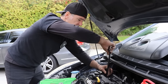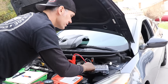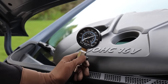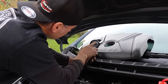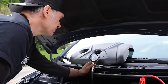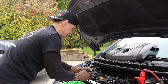Based on the Kia manual, we need to have at least 164 PSI minimum, and it should be around 185. We're going to hook up our Noco here to make sure we have a good 12-volt supply and give it a little boost. Hold the gas pedal to the floor and crank it for a few seconds. First cylinder reading: just a touch over 200 PSI — we'll call it 200. Second one: right there at 197.